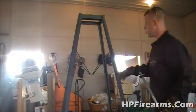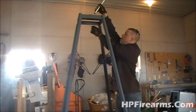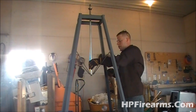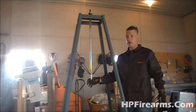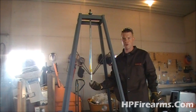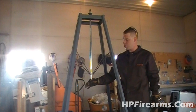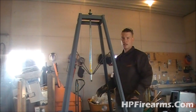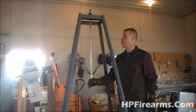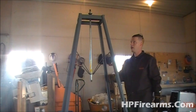I've got our center support all installed and cleaned up now. With this installed correctly, we can put our center shaft right in here, and while it still has just a fraction of an inch of play, it still spins freely. This will keep anything — like removing the battery box or swapping the battery — from pushing it left and right, keeping it nice and stout and secure.